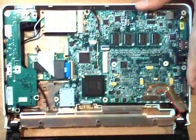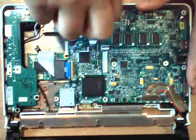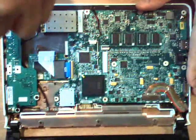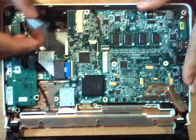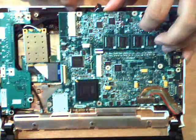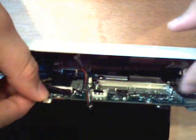Make sure to lift up — not out — like I did with the keyboard; just a quick flip up for these ribbon cables. I can remove this here — that's the Wi-Fi module. I unhooked this cable; it was just kind of wedged in there. Make sure you get this blue tab attached and then you can get a little more wiggle room. You can see the RAM slot right in there.